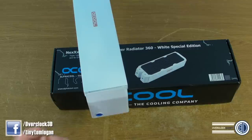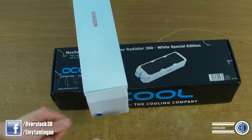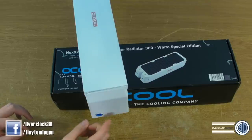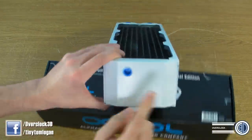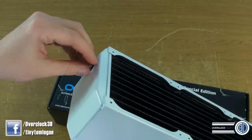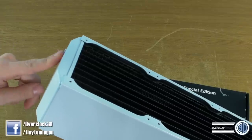You can only undo it and dump all the fluid out — you're not going to have like a drain valve on it, but that will help. And saying about bleeding: if you had this in the top of your case, I would suggest trying to make sure that this is at the top of your system. Because then if that's bolted to the top of your case, you can release the screw and then tighten it back up quickly to be able to bleed the air out. You can use it like a bleed screw.